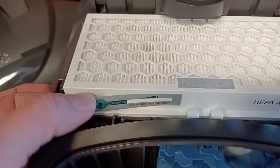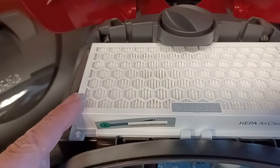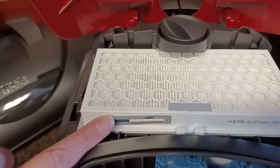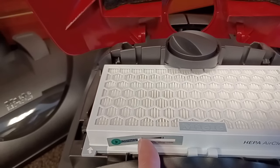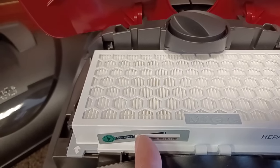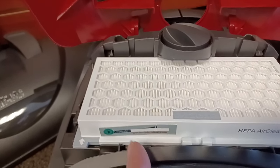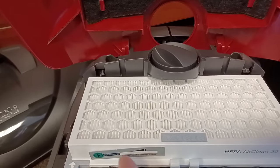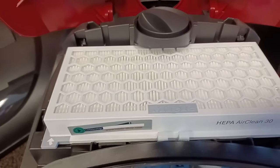Miele also has this little thing called the time strip — it's just a little sticker. You flip it over and there's a little bubble, just a small packet of red dye inside. When these get installed, press the little green dot really hard with your finger — give it a squish. You'll feel it squish and watch a little red line appear. The red dye will flow into the white viewfinder part of the sticker, telling you it has been activated. Don't walk away until you see that red line — you might have to squish it a couple of times. Then as you use the vacuum throughout the year, the warmth of the machine encourages the dye to flow out and start filling the sticker red. Eventually the whole sticker turns red and you'll see the word 'replace' show up — that's your indication that this filter is done.